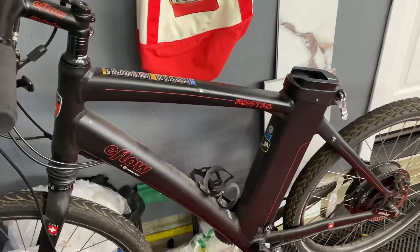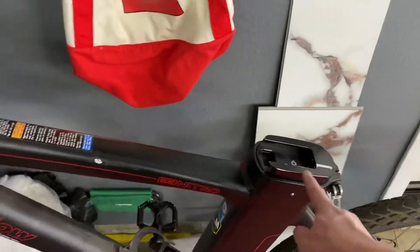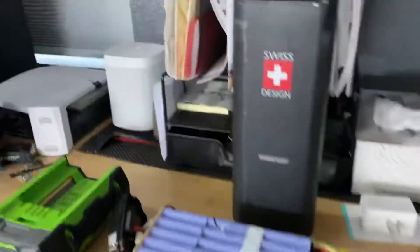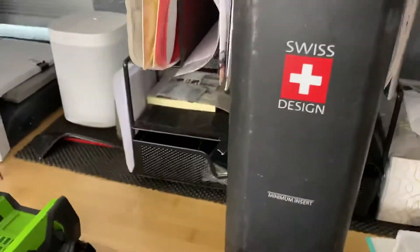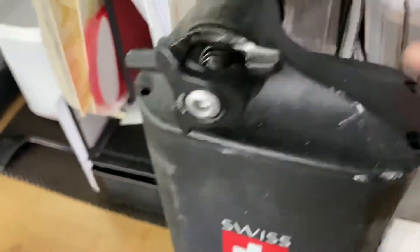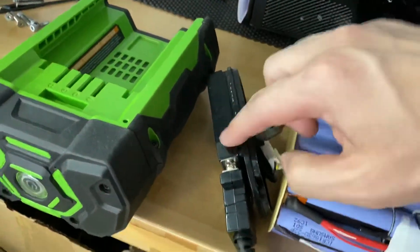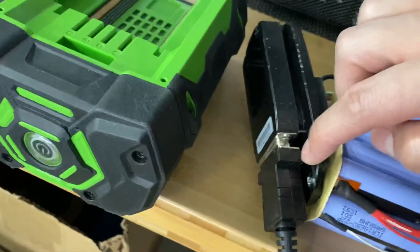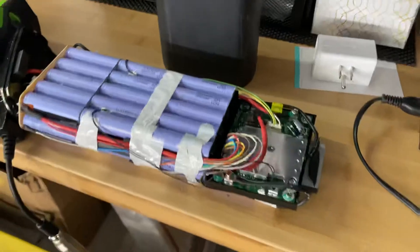You might or might not be able to revive it, so we'll take a look. To start, we're just going to remove the battery, which I already did here. This is the battery — you take out the seat, and there are four things you need to do. You need to remove these four screws at the top, and then there are four screws on the bottom that you're going to remove here. Right now it's charging, because I had just fixed it, and I'm charging it to make sure that it works.